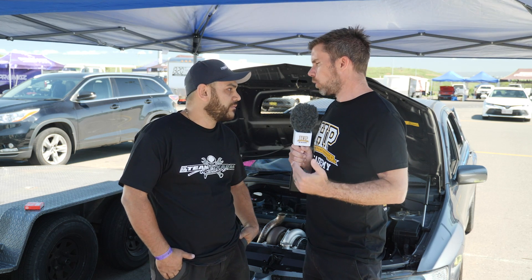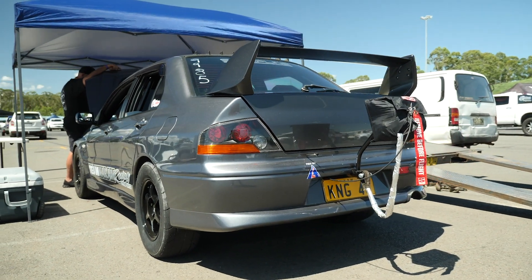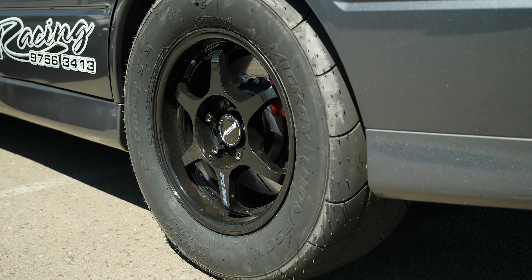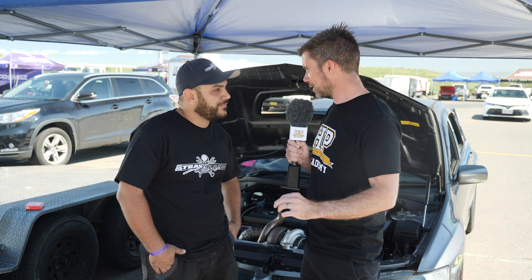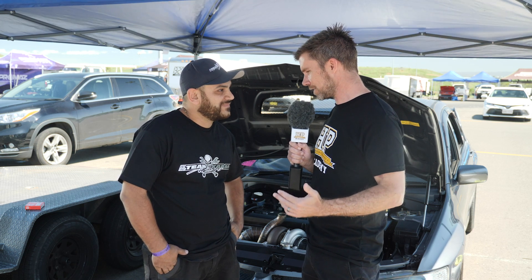What we really want to do is get the car moving off the start line without the engine bogging and without it just lighting up into wheel spin. It's a real fine line and some drivers have an uncanny knack of being able to manually slip the clutch just the right amount. But everything's happening incredibly quickly and as the power levels and grip levels step up, this gets harder and harder to do.